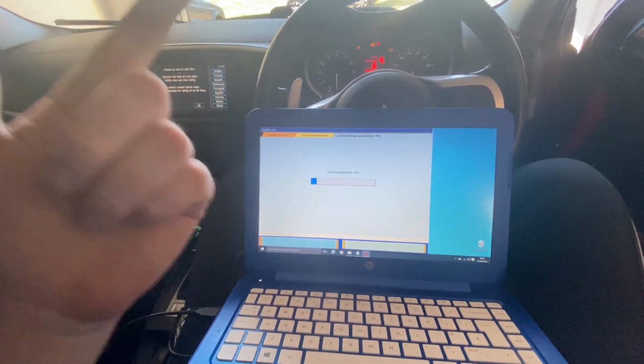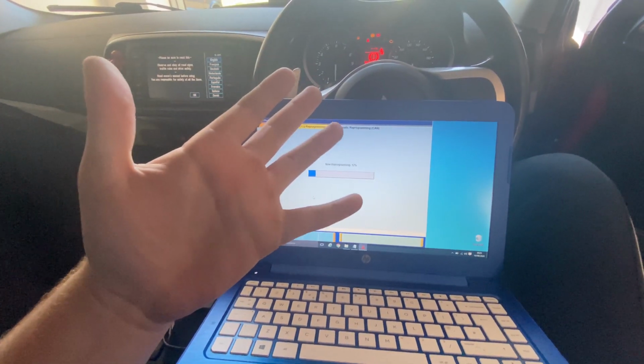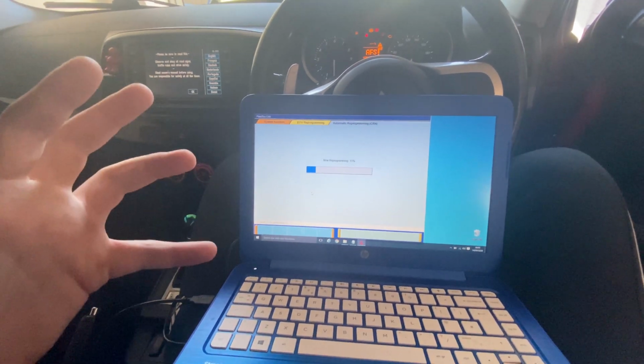That's the engine oil changed, engine filter changed, SST oil changed, SST filter changed. The engine mount has been upgraded, and now we're just going to flash over the new firmware and do a gearbox reteach ready for Chris to take you home.